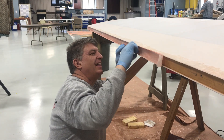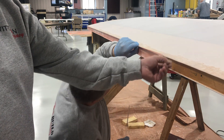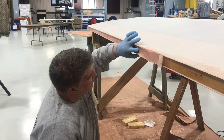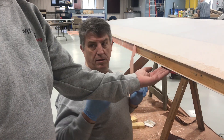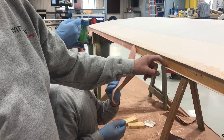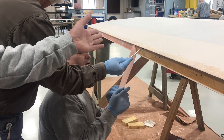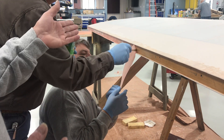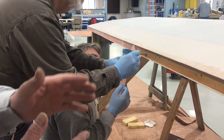The trailing edge of the legacy wings are built just like the tailwind. We've got a gap seal built in with the sheeting from the top and the bottom of the wing to seal up the aileron and the flap. It created an interesting problem with the fabric. So we rolled the fabric around the bottom of the wing and up to the trough, but as you know an inside corner would be very hard to do. So what we elected to do here was we pre-poly brushed some shrunk fabric that we shrunk on a frame, and we're adding that in to this trailing edge piece as a separate piece to lock this all together.